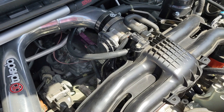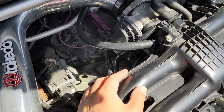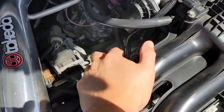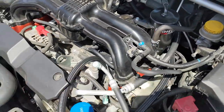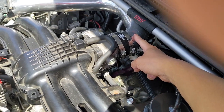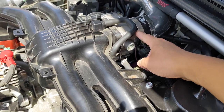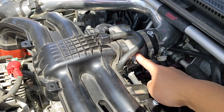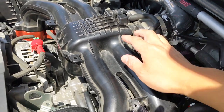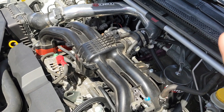If you have a direct injection engine that would be more of an issue at high RPMs. There is a vacuum sort of push-pull system happening here as well, although I haven't had any oiling issues on this side so I'm not that worried. What does happen is with the breather valve, if you run the car pretty hot and pretty high, the air is coming out of here and back into your intake system, pushing oil and oil vapors through this right before the throttle body. When the throttle body gets saturated with oil it can gum up, and you'll get rich codes or other engine codes — mine were like bank sensor rich — and you'd have a rough idle or through a certain RPM range you would just kind of stutter.